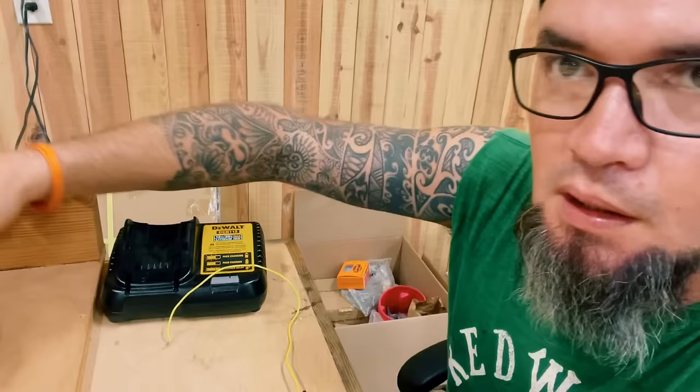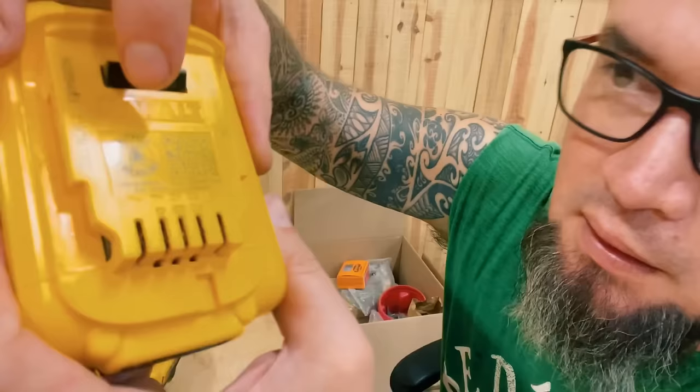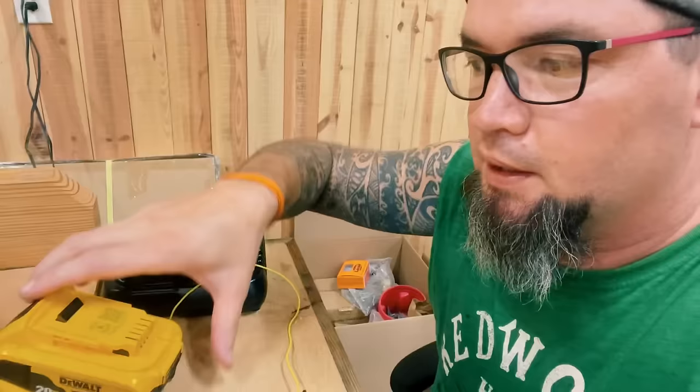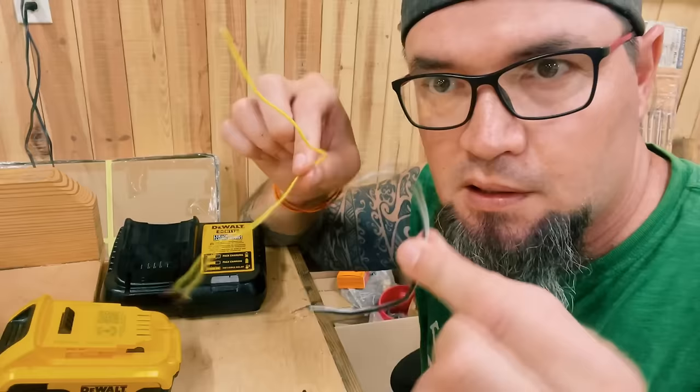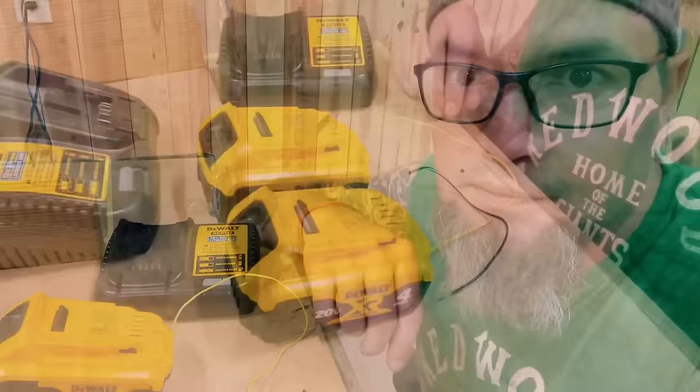What you're gonna need is a battery that is fully charged — we'll use that as our kicker. You'll notice on both of these batteries, beside the charging ports, there's a B positive and on the other end there's a B negative, and the same thing on the opposite. So what we're going to do is take a couple of pieces of speaker wire and put a little bit of juice from this into the bad one. That should give it enough energy for the charger to pick it up and actually acknowledge that there's a battery in there that needs to be charged.